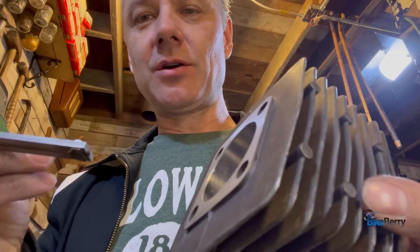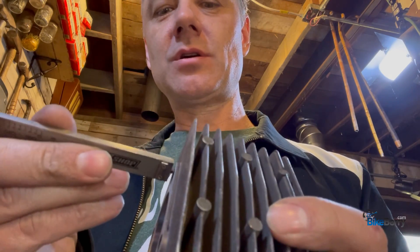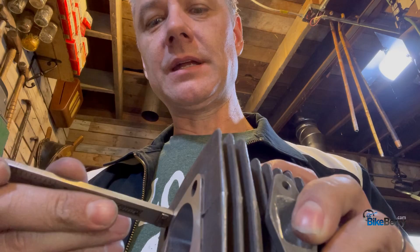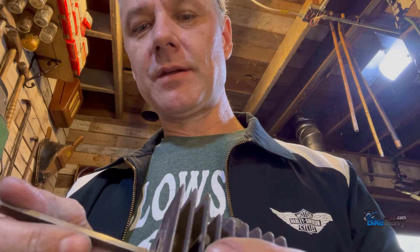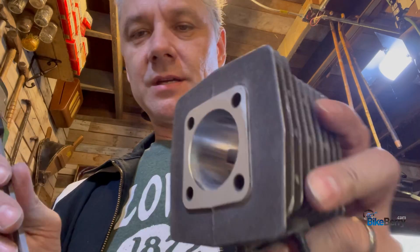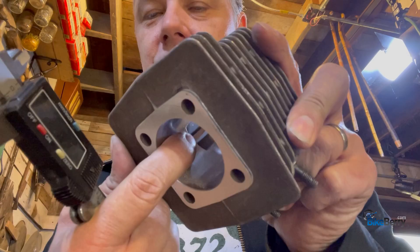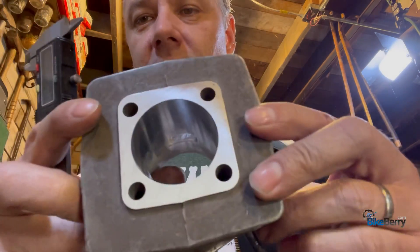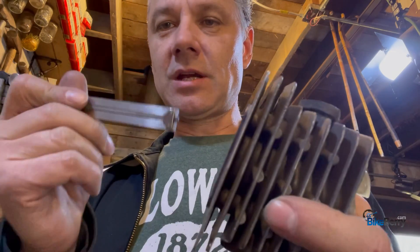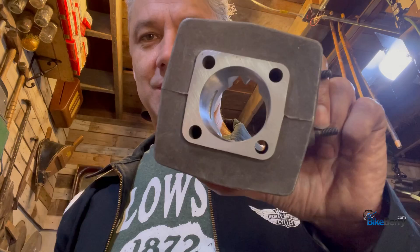I'm sanding on it — it's very flat. I got my calipers. We're going to check the depth around the perimeter and make sure that it's equal all the way around. Once we've done that, you can feel confident. The true test is to take and measure from the top here to your transfer ports on both sides, and make sure everything is even all the way around. Take your measuring tools and measure those, and once you get it nice and even, you're good to go.